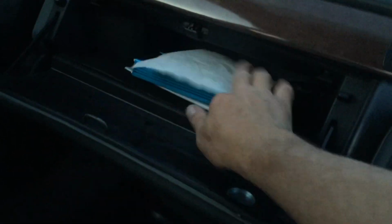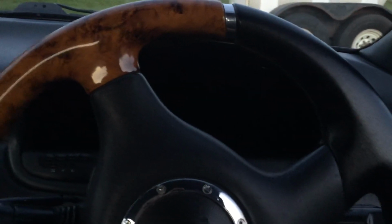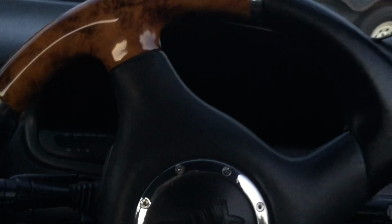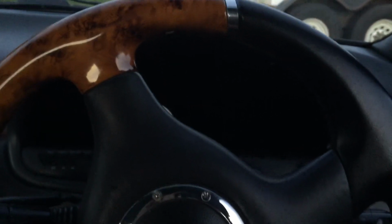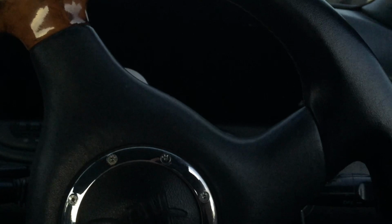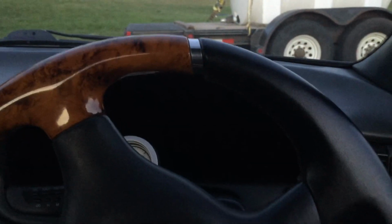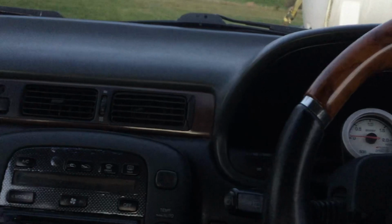So anyways, when I first bought the car, probably about 5 years ago, I knew it ran good and I liked it. I ended up paying for it through a family member, and springtime come and I was all paid up. I went and pulled it out and it was in limp mode, or the fuel cut at 2100. I've been doing all this other stuff like ground wires, fuel injector clips, coil pack kits, all sorts of stuff to try and get it out of limp mode, and it would come out. It would work good for a bit, but I'd take it to work and it'd be running good, and then it would rain at work and I'd go to drive it home and I'd get a fuel cut at 2100. Super frustrating because I love the car.